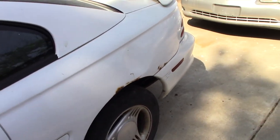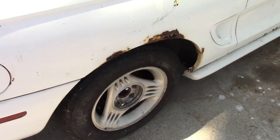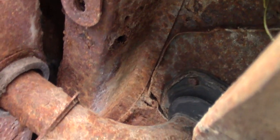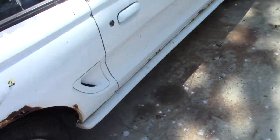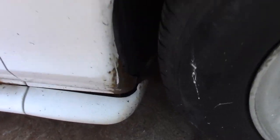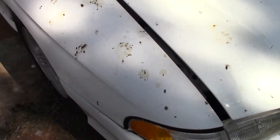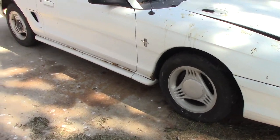The rear is a little deceiving - it has some flake, some rust. Down underneath you can see the typical quarter rust, and the rear frame is doing the whole brown flake. It's not gone to the point your finger goes through it, but if you started hitting it with a hammer chunks would come off, so I don't know how strong this would be as any type of derby car - that's why we're leaning towards racing this. The front frame isn't the cleanest either; it has typical rust and inside the strut tower - a very common fox body platform issue - it's starting to get that flake buildup. I'm honestly surprised it made it over 200,000 miles without rotting out much worse; somebody at one point probably had this kept indoors.